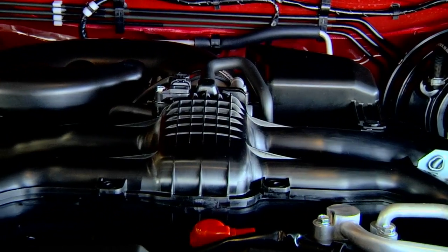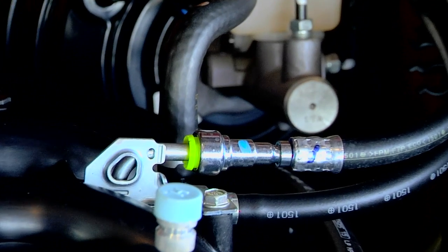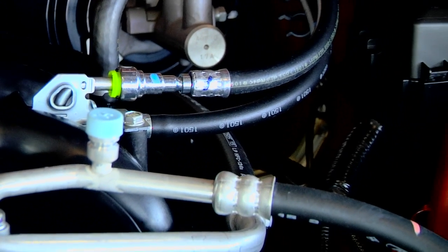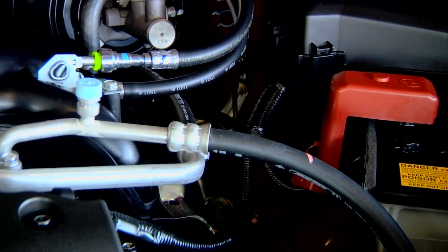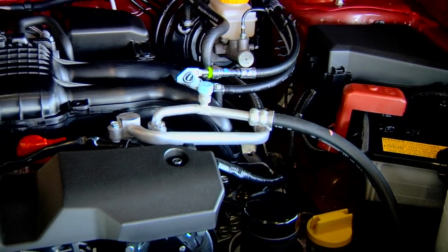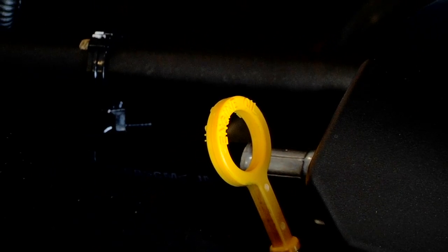Now, Subaru has really lightened up the engine. Obviously, with the lightweight, it has improved fuel economy. Fuel economy on the vehicle has now risen to 27 miles per gallon highway. One item very important to understand is that with the lighter weight components in the engine, the tighter tolerances that Subaru put into play in order to maximize fuel economy, the vehicle must run on synthetic oil. Now, the nice part about synthetic oil is you only have oil changes at a 7,500 mile interval, not the old 3,750 intervals that were out previous years.